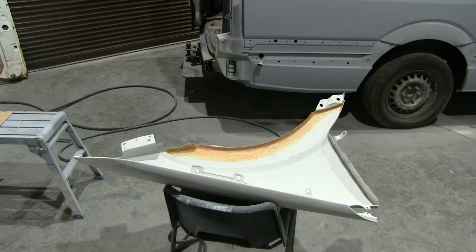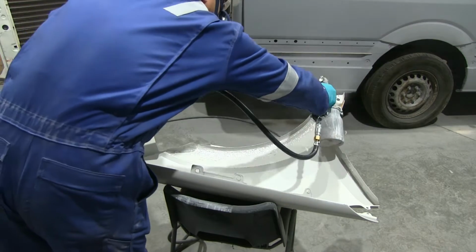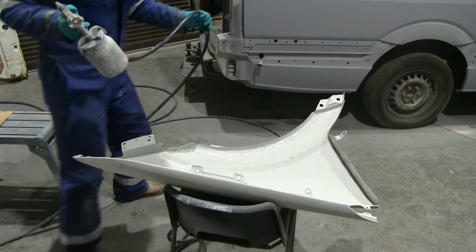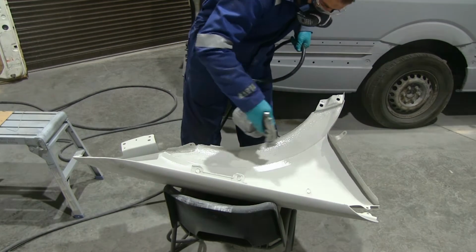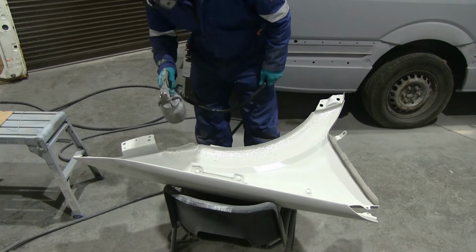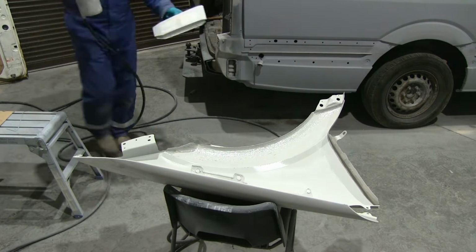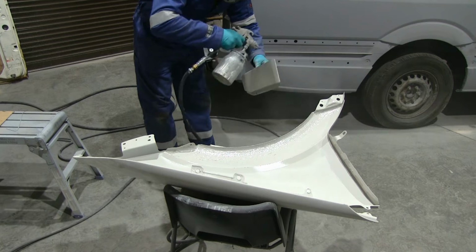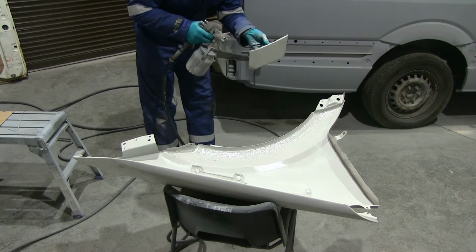I really hope for good results and a fairly long-lasting project. Obviously, it's been sealed over the top of that with another coat of sealing primer, and again I just build up a couple of coats to seal it properly and make sure there are no pinholes or anything like that that will go through. I also gave a little coat for the fuel tank cover.